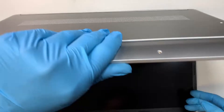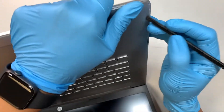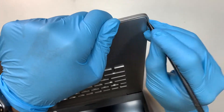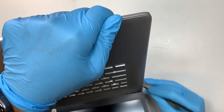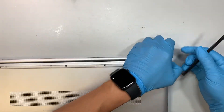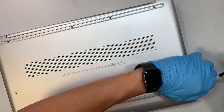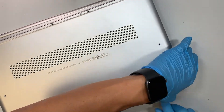What I like to do is go in between the palm rest and the back cover. Start from the corner, from the side. Take your time when you pry it open — try not to dig it too deep because you do not want to mess up the internal parts of the computer. Be very gentle when you get it open at one corner, and just kind of wiggle around. Get the plastic prying tool and slowly pry it open all around the corner.